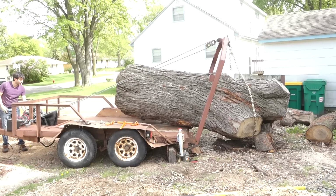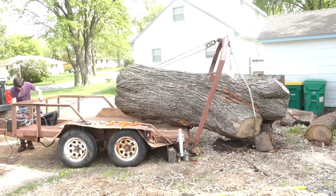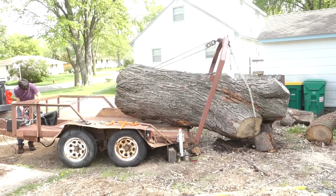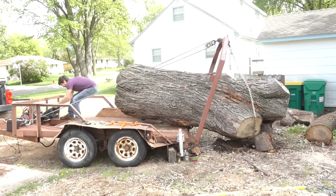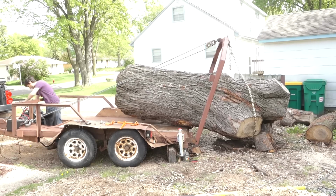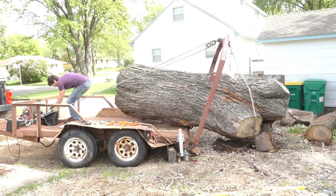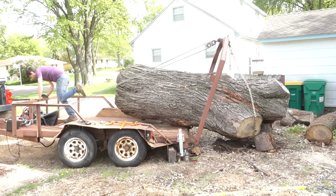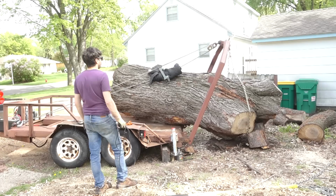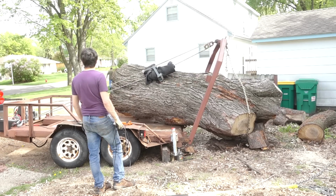Now as I'm messing with that blanket trying to get it out, I thought I'd answer a question I get quite a lot whenever I show the winching, and that has to do with why I have a blanket on the cable. The idea behind the blanket is a little bit of risk mitigation as far as the risk associated with the cable or an anchor point or something in the whole system failing under load. The blanket weighs the cable down and should help to direct the cable down into the ground as opposed to going up into the air.